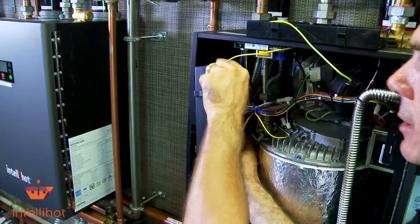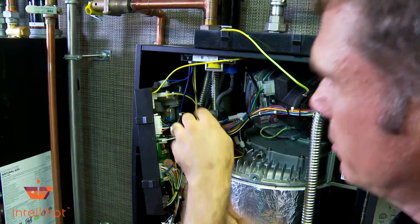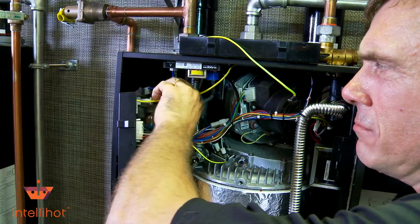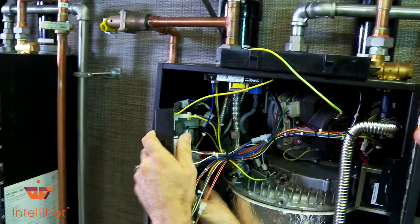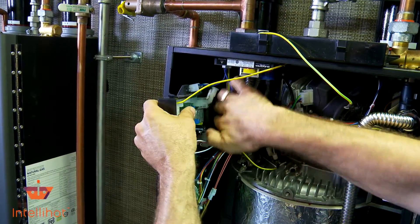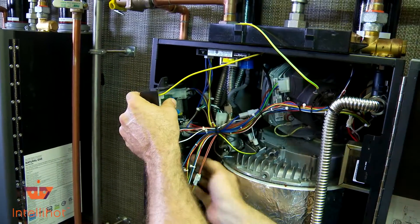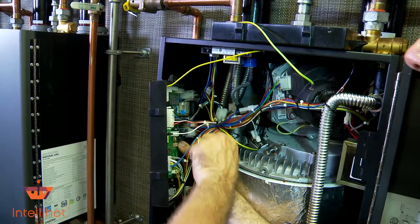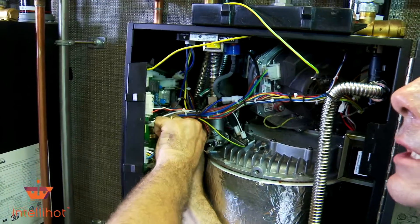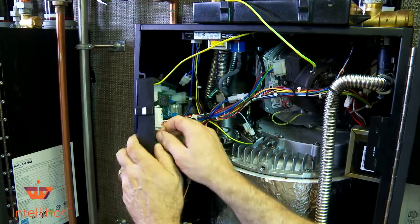I have a ground wire in my way, and a short wire going up to the igniter box. There's another short wire going to the wiring harness that has all the zip ties on it. If you want to cut the zip ties loose, make sure you have replacements, because the zip ties are there for a reason — they keep the wires from touching hot spots like the top of the engine, sharp edges, or the stainless metal.